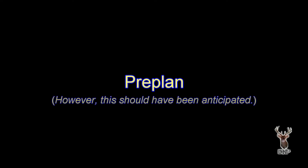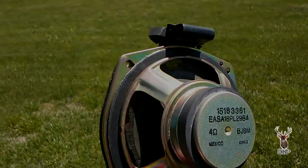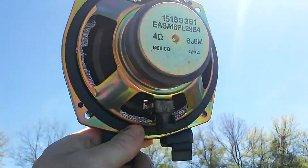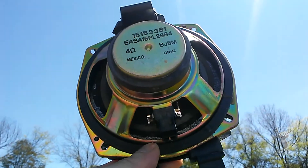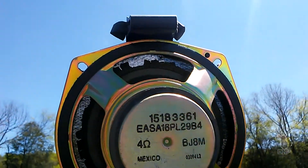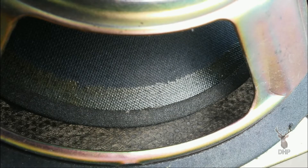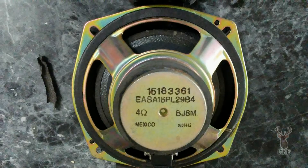There was no pre-plan for this project as all we were going for was replacement of the head unit for hands-free cell phone operation. We had a failing unit and a rattle in the door, and we mentally associated those two things, only to find out after the replacement that the surround was completely gone out of the left speaker. The right speaker didn't sound particularly bad, but when we tore that door down we found out why — it was inoperable. The voice coil was out.